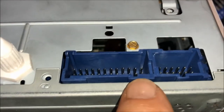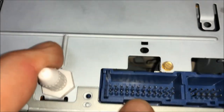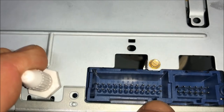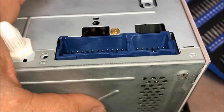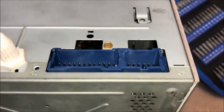The first thing I did was hook up an electrical connection to pin one and five — that's what it said on the internet. B1, which is this bottom row, is positive, and the fifth pin is for negative. I hooked that up to a battery and it did operate the player. I pushed the eject button but it did not work, so that means I need to disassemble the player.